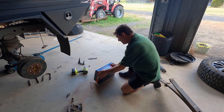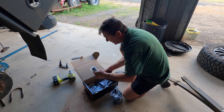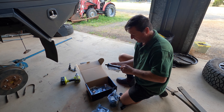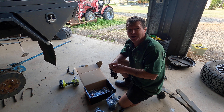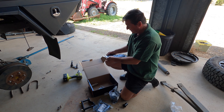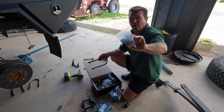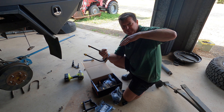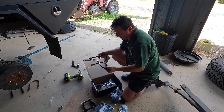Alright, we've got the rear suspension component kit for the Ranger PX3. Let's see what we got. Pretty good neoprene — all greasable as well. We've got the hangers, really heavy duty. Just a disclaimer: I used to work on cars for a living, then I became a steering and suspension specialist. No beer involved at the moment, but that'll come soon. It's pretty good quality stuff, and we've also got the center bearing lowering kit as well, just to bring it down so we get a nice straight line where the shaft splits — otherwise you get plenty of vibration. All in all, good quality kit so far.